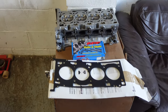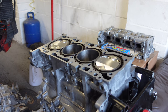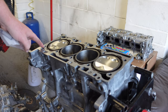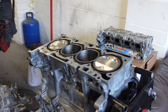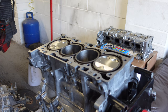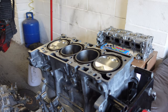Before actually installing the cylinder head, there are a few things I've got to do first. I had to phone up Rossport and order some parts, including this inline oil filter that sits in the deck of the block. The old one picked up some metal shavings when the engine blew, which actually saved the cylinder head - there was no scoring on the cams. It's good practice to replace it anyway since it's only about ten quid. Also, when they decked the block, they had to remove the little locating dowels, so I've got two new ones to fit as well.